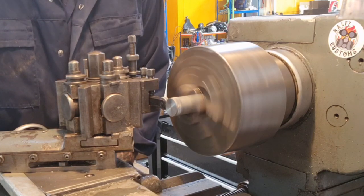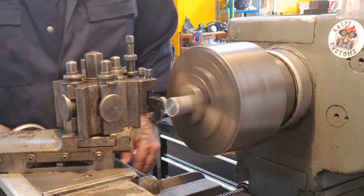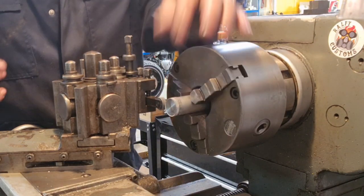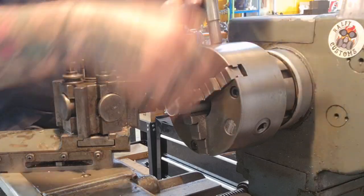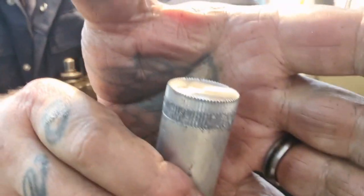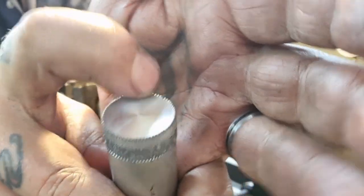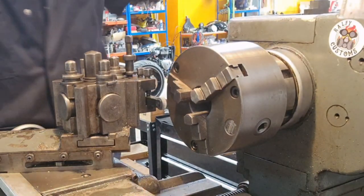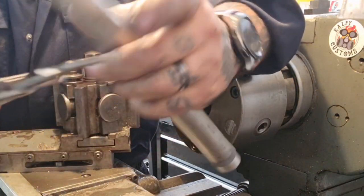Bear in mind, it's cutting, but it's also deforming. I'll show you, as well as cutting those little grooves. See, we've got that line. I'll take this out and show you. So, you needed more lube really. But you see, we've got that line, but also, if it picks up this top edge, it's pushed material off the top of the bar, and what that does is it lets us increase the size. So, let's go old school.